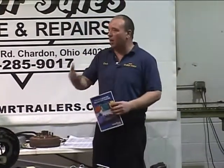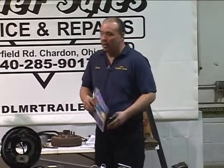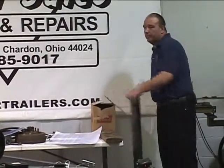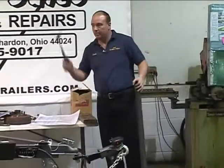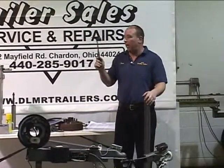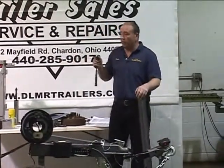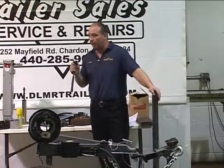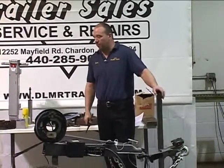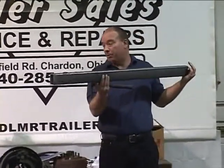Watch your tire pressures, watch your dry rot — that should resolve your tire problems. Next is framing. Go around and check your frame under your trailer with a hammer. Last year we condemned six trailers from rotted-out frames — two of them in the tongue and the rest right over where the axles meet the frame. Especially if you have a tube frame, the inside of that tube is not protected at all.